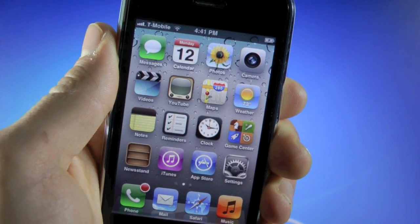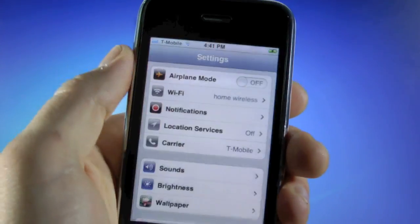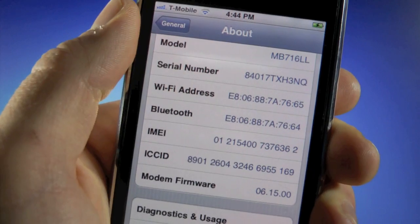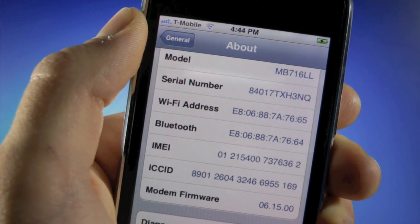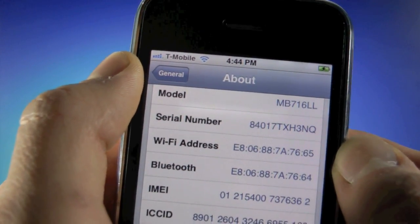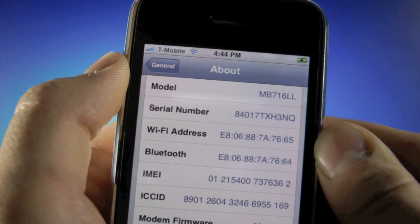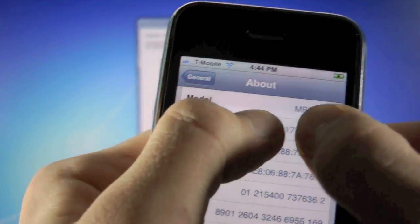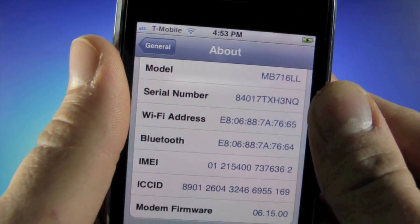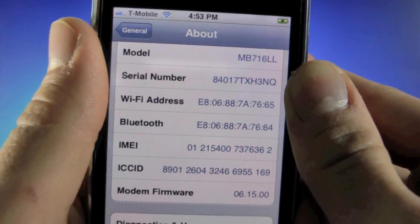This unlock is not for every iPhone 3GS. The newer 3GS's have the new Toshiba baseband chip. To check, go into Settings, General, About and read your serial code. You have to look at the third, fourth, and fifth numbers — for example, mine is 017. The third number means what year your iPhone was made in; the fourth and fifth are the week numbers. So mine was made in 2010, week 17. Any iPhone 3GS made on or after the 35th week of 2011 cannot unlock at this time.